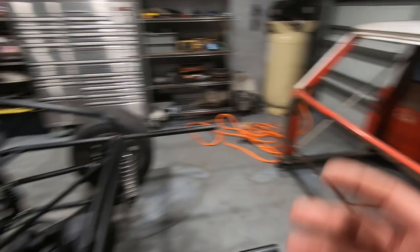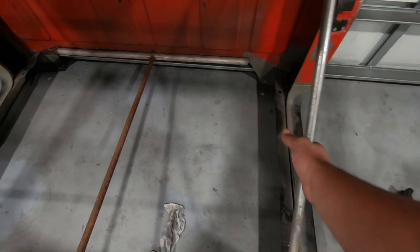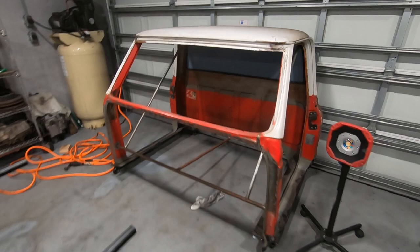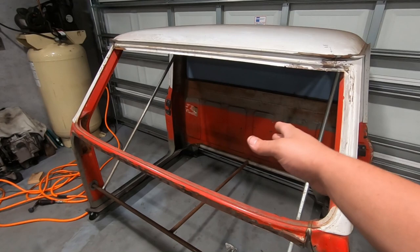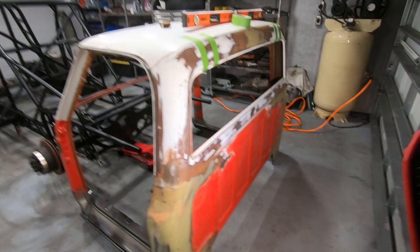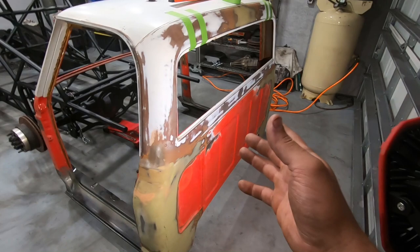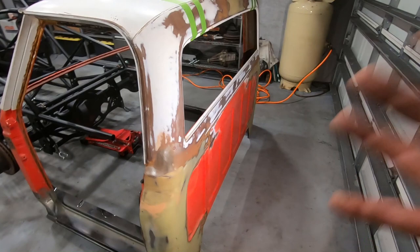Today's video focus was actually supposed to be about the cab until we got sidetracked with having to repaint the chassis. So today we're going to be trying to get the cab put over the chassis. We need to cut out all of these supports in here - I put those in when I sent the cab to my buddy Sean to have the rockers done. He did a killer job, but that was just to stiffen the cab up while it was in transport and keep its shape. We're going to set it on the chassis and hopefully make a very big cut in this back portion to get it slid over the cage.